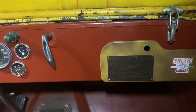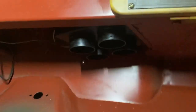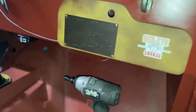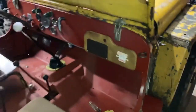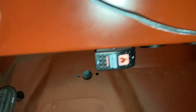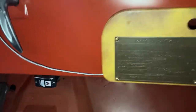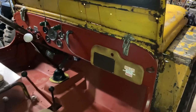Here's the heater installed. Four bolts — and there it is. It's getting late, getting dark. The heater is in and finished. It's up under there. I'll tidy up those wires later — that's my phone charger cord. You can't see it and it doesn't get in the way of the passenger's feet. I just double-sided tape mounted the switch here — so that's high and low. It blows right down there. I'll put the doors on and in another video I'll take some temperatures inside the cab and compare them with and without the heater.